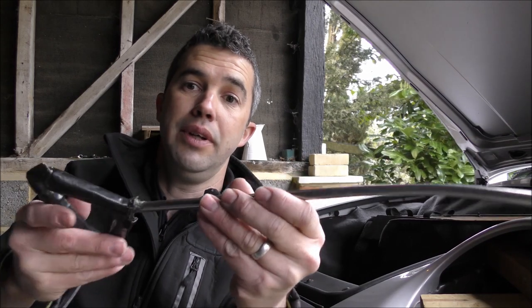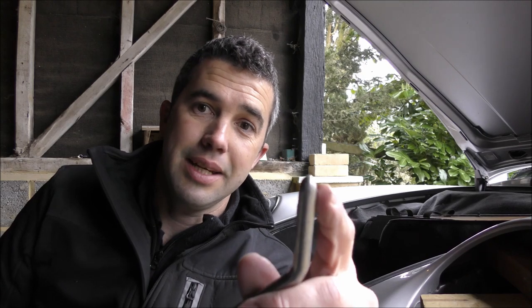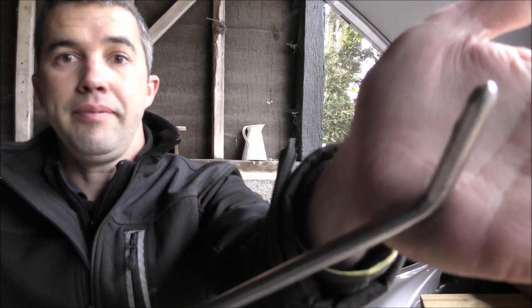I've now reached the finishing stage of the process. I've done a bit of blending, taken out some of the ripples and leveled things out, and there are still just a couple of tiny little low spots remaining. I'm defaulting to this very old tool and using just the bare tip of it. Still plenty of heat on the panel to look after the paint. This tip is going to get underneath the low spots and just lift those tiny bits up — levering off these wooden blocks very gently and with precision, finding the centre of each low spot and pushing it up one at a time. Then I'll probably finish with a bit more blending before giving it a polish.